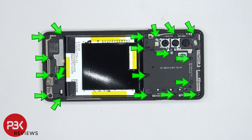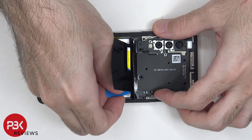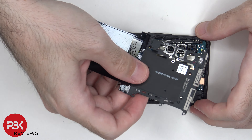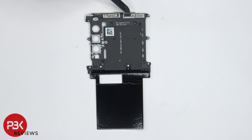There are 19 Phillips screws which need to be removed. Now that the screws are removed we can lift up and remove the top plastic cover. The NFC antenna is located at the center of the plastic cover, and there are some antenna lines which are these light gray color lines drawn on top of the plastic.